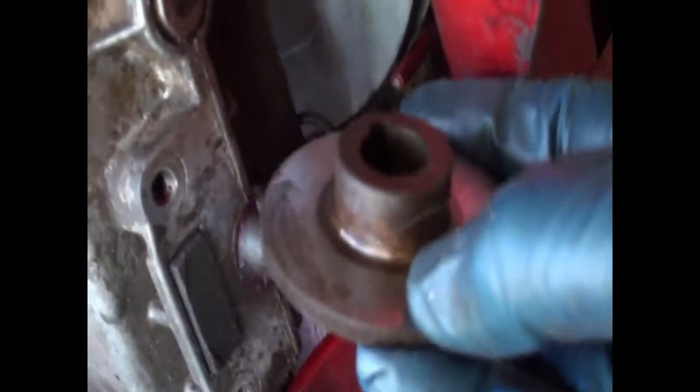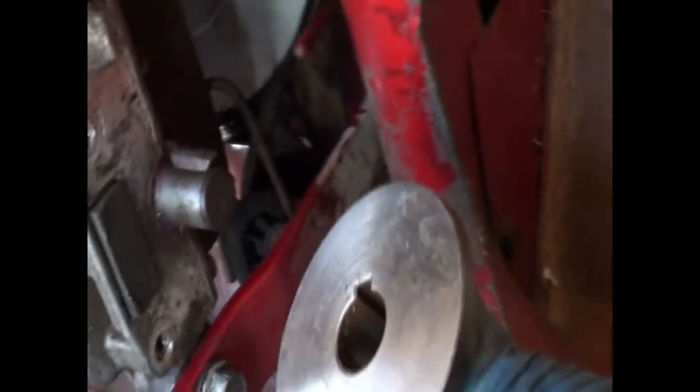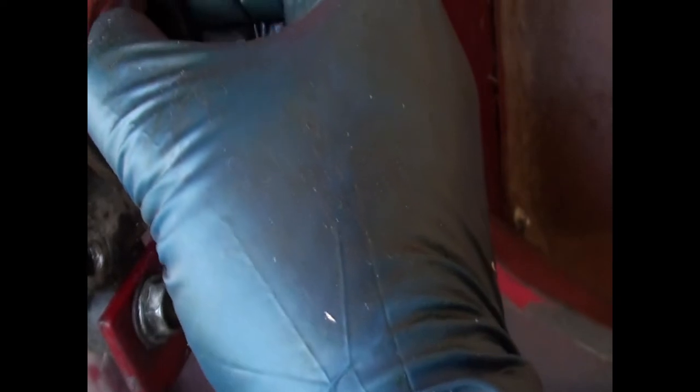So the first thing I want to do is put in the key. This goes in this disc with the smooth flat side to the back — toward the transmission — and this raised portion sticks out front. The smooth part is back toward the transmission. Let's see if I can get that on. And now the disc is on.